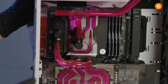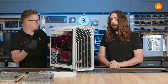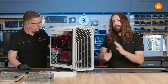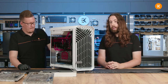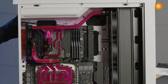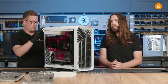So this is about Matrix7 and foundation parts, that the ports on the monoblocks will always be the same, it's Y, right? Y axis? I mean, they remain the same in both Y and X, yeah, most of the time. And we prefer to align them with one of the GPU ports. So yep, if it's not possible on the left set of ports, we'll move it to the right set of ports. Occasionally, we might need to move by 14 or 7, but until now we've managed it on a huge range of boards, from the tiny little Z690 I block, which is barely bigger than a Velocity.